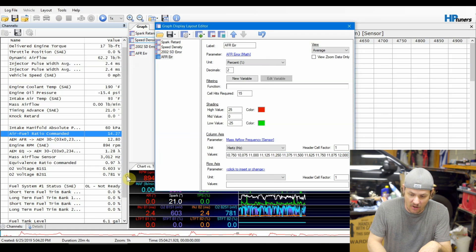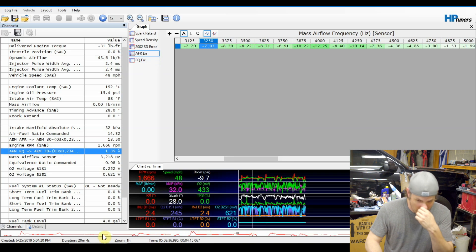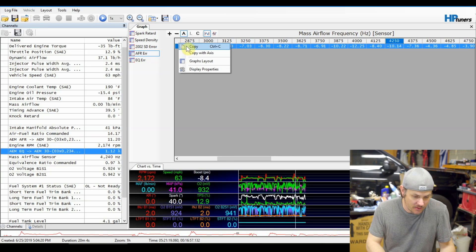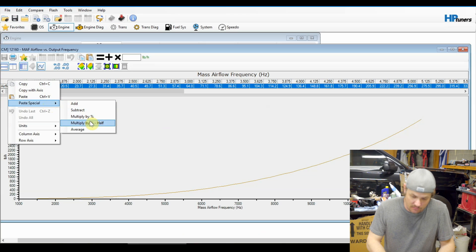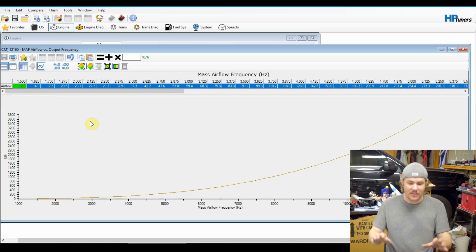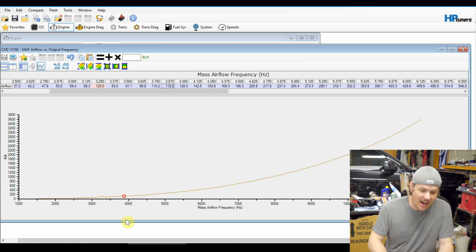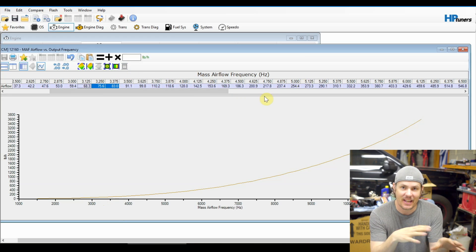If we start scrubbing through some of this data, you can see what it looks like. You go out, do a long log, get all this data. When you're done, come in here and just like everything else, copy the whole histogram, jump back over to the table, highlight the table, and do Paste Special > Multiply by half — but watch the graph down below. Not a whole lot of changes is a good thing — it means you have a fairly smooth graph. If you see any spikes show up, like if you put in a value and you see a spike pop in there, you need to find that and smooth it out — you can probably interpolate between those for now and hit it later on. Do this two or three times to kind of get everything dialed in.